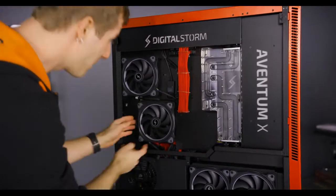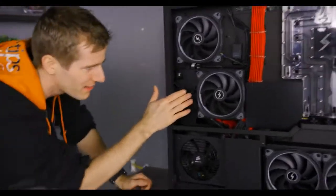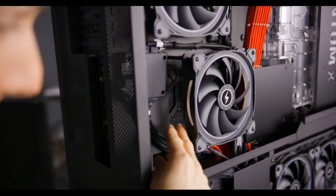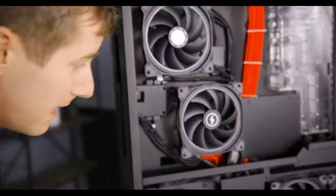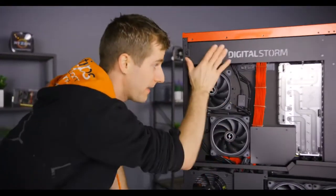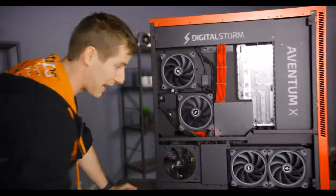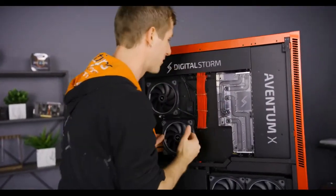And then we've got this one that is actually dedicated, can you see this, Brandon? Come get an angle on this. That's actually dedicated to the back of the CPU, where it mounts to the motherboard. Because some motherboards actually do have heat sinks or VRM components back there. And normally, they wouldn't get any cooling other than what they get through the copper material that the motherboard is made of, conducting heat away from them to somewhere where there is a fan or a heat sink. So they've got a fan that just blows down on that. That's all it does. That's all this fan exists to do, a 140 millimeter cooling fan.